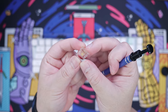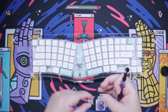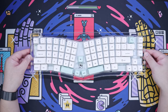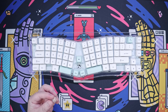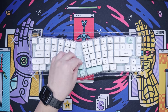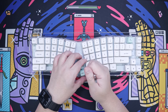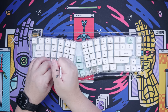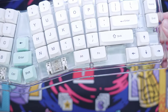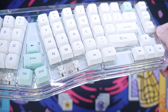Since all Gateron North Pole switches are transparent, one way to differentiate them from each other is the color identifier at the bottom. What I appreciate about this latest version of the XBOWS keyboard is the fact that it now features hot-swappable sockets, which means not only can you customize the keycaps to your liking, but you can also customize the switches depending on your preference. It's north-facing though, so you're somewhat limited in terms of compatibility with short pole switches and cherry profile keycaps. As for the stabilizers, at first glance they don't look pre-lubed at all, but when we tear this keyboard apart, it actually has some faint lube. It is also worth noting that this keyboard supports plate mount stabilizers only.